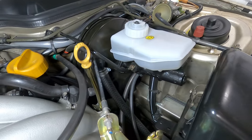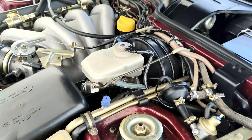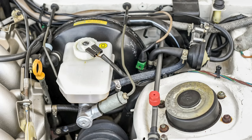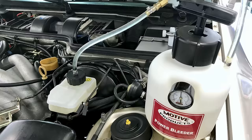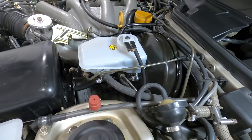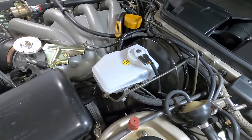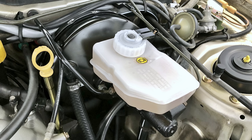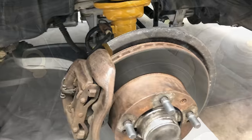Another deviation from the factory setup on this side is at the power brake booster and brake master cylinder. Over the many years of production, Porsche deployed both ATE and Girling brake system equipment on the 944, where this 1988 model year was delivered with a Girling setup. While I was restoring the entire brake system, I found that the Girling master cylinders were difficult to come by, so I converted everything to ATE. The ATE parts bolt up the same way and are factory equipment that Porsche used at the time, but it is a minor change from the original setup on the car. The only noticeable difference is in the color of the master cylinders — the ATE version is black and the Girling one is silver.